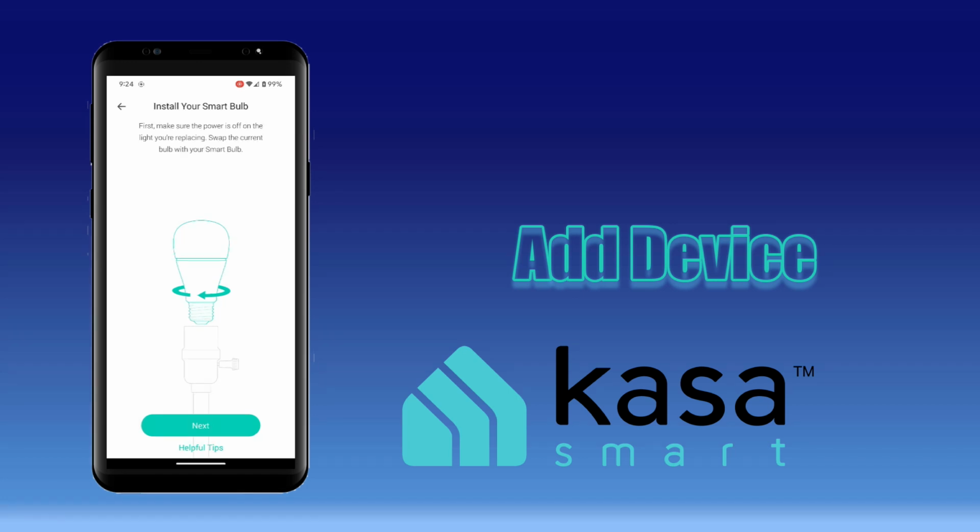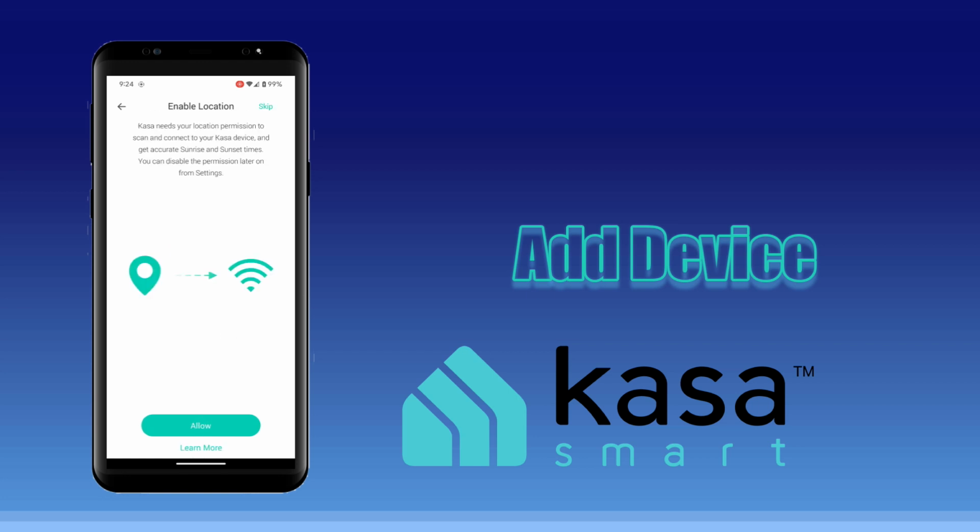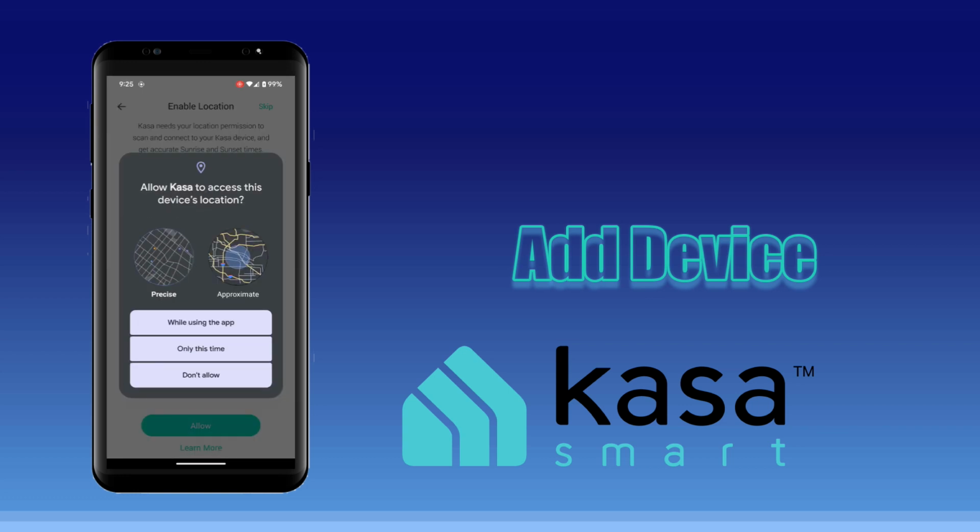We now need to install your bulb in the light fixture. This doesn't need to be the final location for the bulb. You could use a lamp during setup and then move the bulb to its final location once setup is complete. Make sure the power is off at this time. Select Next, then turn on your smart bulb. It should flash three times to indicate that it has entered setup mode. If you get a screen asking for location permissions, just select Allow. I would allow only when using the app.